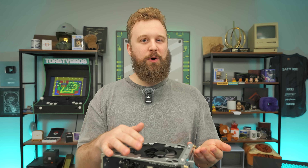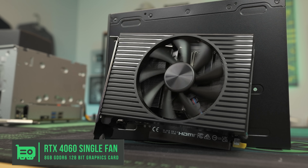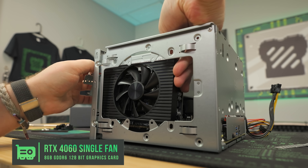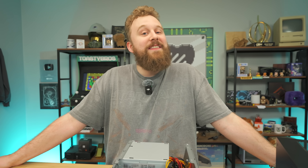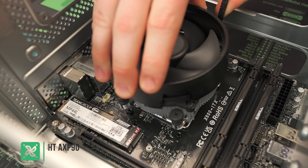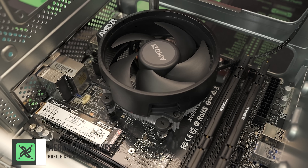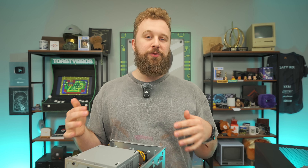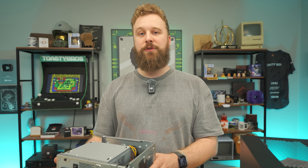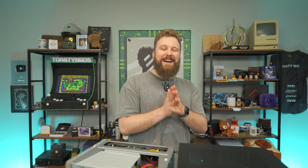For the GPU, I was considering an RTX 3060 or the inevitable RTX 5060, but the 3060 wasn't enough power. So we decided to meet in the middle with an RTX 4060 — specifically an OEM model we picked up off eBay. We paid a bit of a premium, around $320 for it. Realistically, a compact two-fan card would work inside this build as well — you just need to find one that fits. We also went with the Wraith Stealth Cooler for our 7500F. We originally planned a Thermalright low-profile cooler, but the mounting hardware wasn't right for AM5, so we had to audible to the Wraith Stealth. Throughout testing, we'd really recommend a low-profile CPU cooler for better temperatures. All in all, $850 for a very solid build.